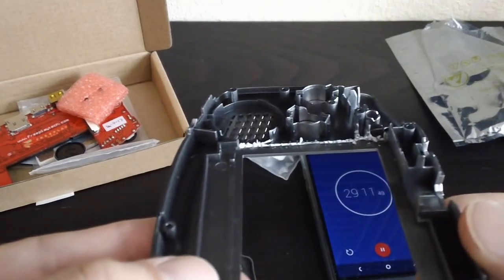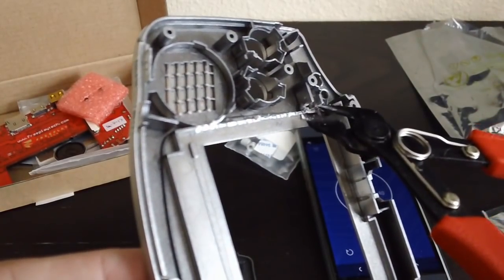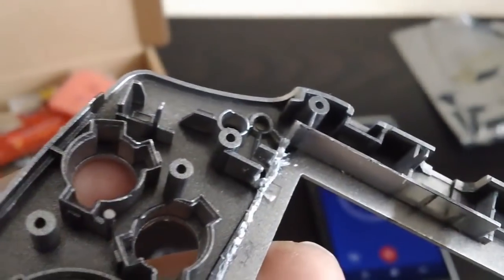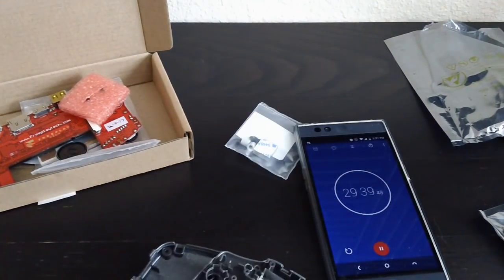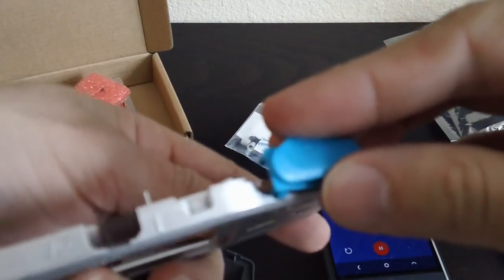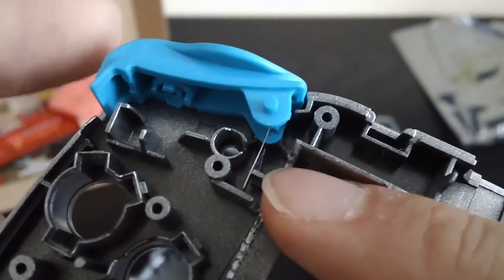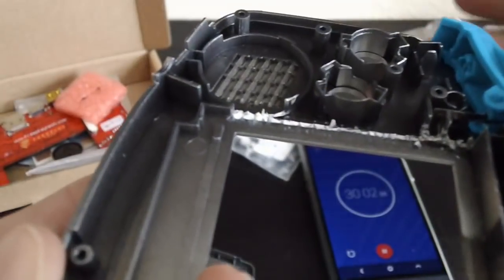You see — much easier. You just cut up into little segments and then pull them out one piece at a time. Make sure though that you keep this little part right here, because the right shoulder button has to go in like that, and the little spring on it sits right there on that part. So make sure you don't cut this one away, because it needs it for the spring. But that little tip — you can go ahead and use pliers and then just smooth it out later. That makes that job a heck of a lot easier.